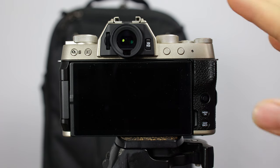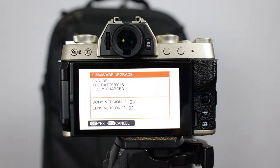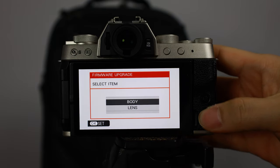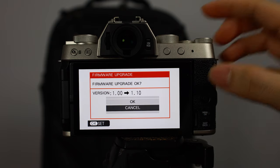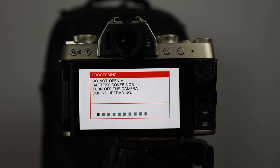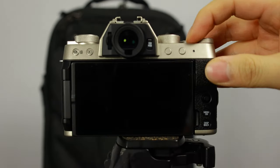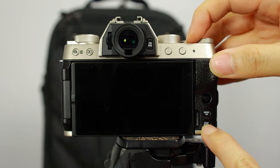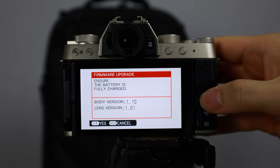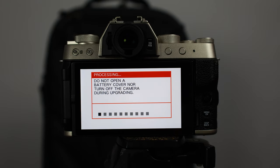With the SD card back in the camera, push the display button and hit power again. We're back on the same screen - push OK, select the camera body, and we're going to go from version 1 to 1.11. Select OK and let the firmware update. Now that the body firmware has been updated, power off, then hit the display button again because we're going to update the lens. Select the lens, hit OK, and let it do its thing.